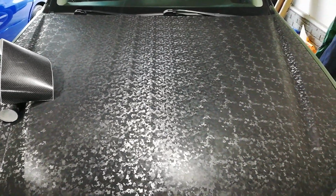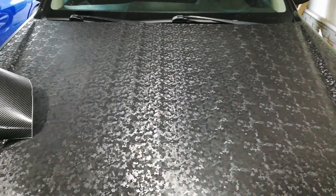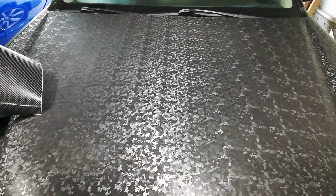And even though on the center here I had squeegeed it down the amount that I typically would for True R carbon fiber, once I popped up this side to try to glass it out, the center hinge that I created actually popped off because it was low tack. So that was kind of neat. Just something I wasn't anticipating.